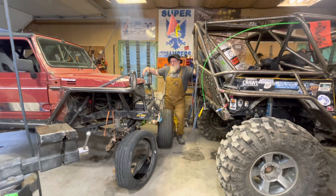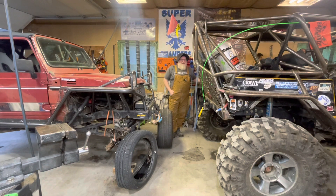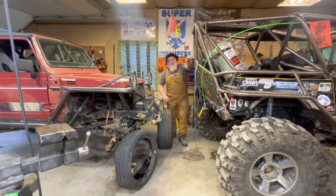So I'm working on some rigging here, getting the rig backed up. I got a ratchet strap holding the front axle up to the frame on Waffles here. Deflated the airbags on the Sami-Mog. This is a 3,200 pound basket lift vertical lift strap. The goal is to sling the tires over the strap.